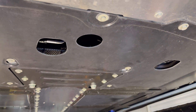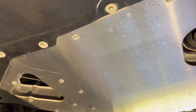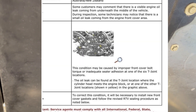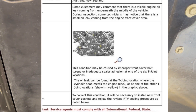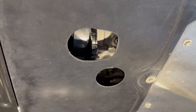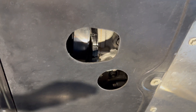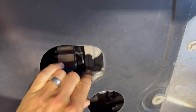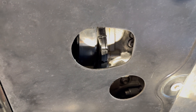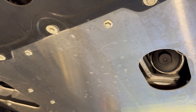One other thing — there is a service bulletin right now on these cars for the front oil seal. Right there is our front balancer, and it's made of aluminum. Most flat-plane cranks are balanced pretty well and don't need a harmonic balancer, but this one actually has an aluminum one just to help with vibration, which I thought was interesting. You can look in there and see if you have any oil around it — that'll tell you if you've got a front seal leak. I do not, which is great. But since there is a service bulletin, you might want to check that while you're under here.